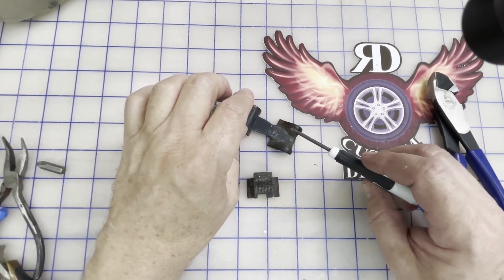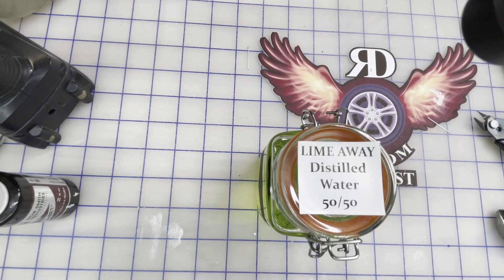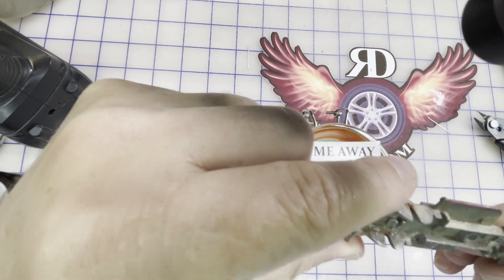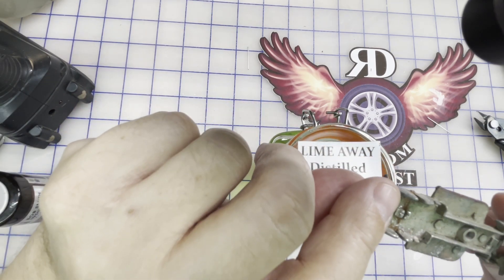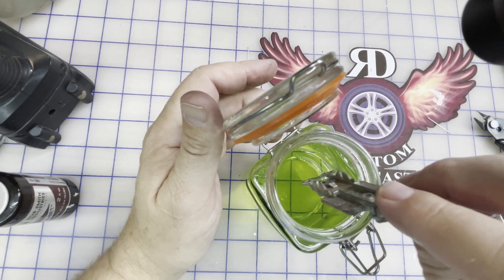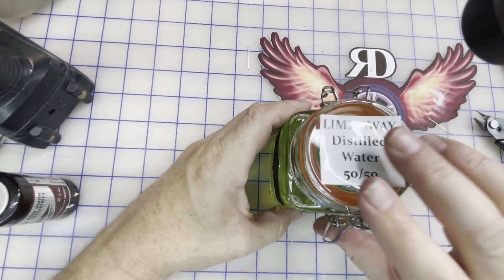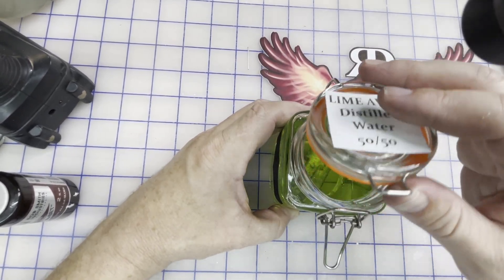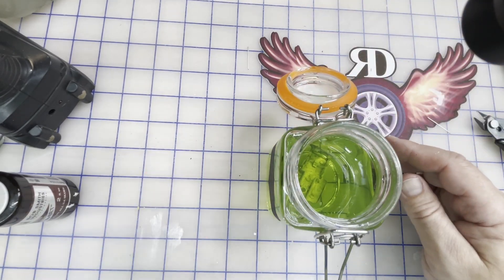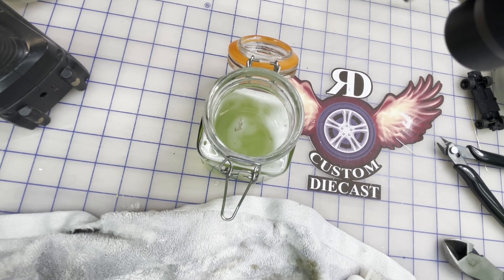That right there is fairly disgusting but it's not too bad - not as bad as the rest of the car. We're going to dunk the base in some Lime-Away and distilled water, 50/50 mix. Three minutes guys, only three minutes. I would suggest not walking away from this unless it starts getting dark - pull it out before it gets dark. Three minutes is about the max. We'll pull it out in just a second, wire brush it, and polish it.